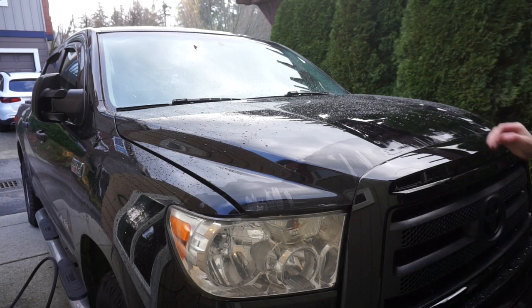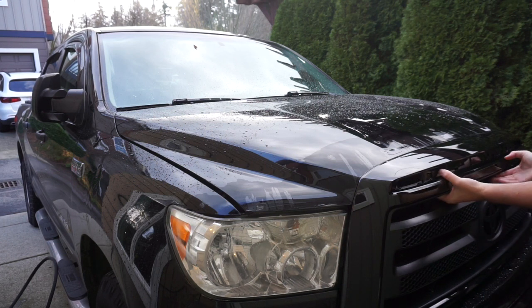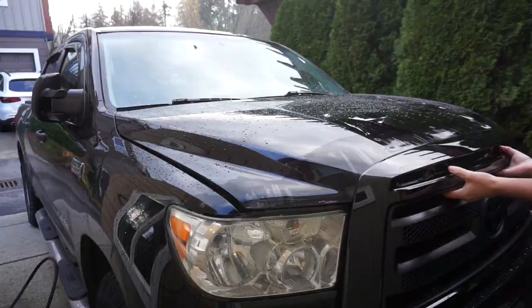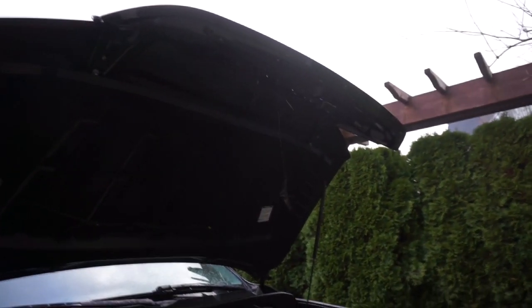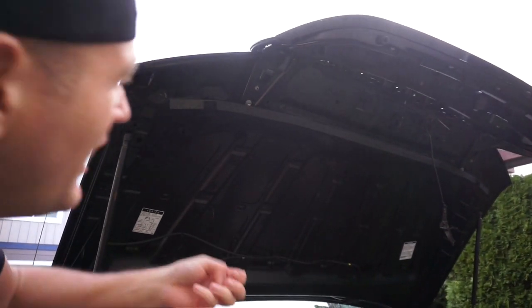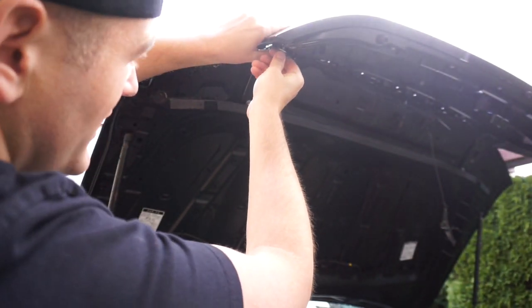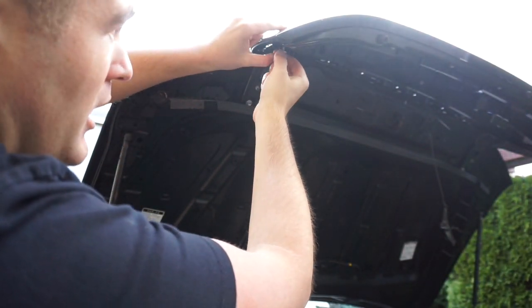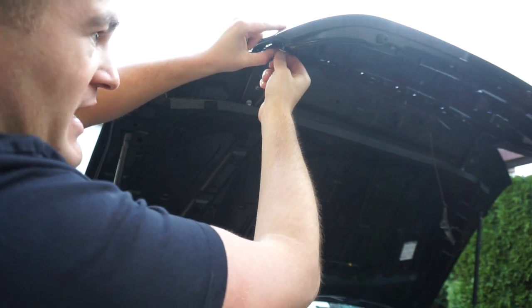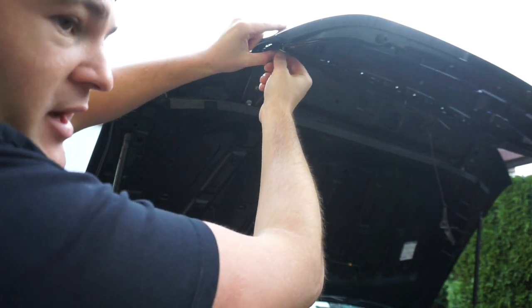Okay, I think it's unhappy because of the latch, so let's go ahead and pull it back up real quick, and we'll get this side latched. Okay, now that you've got the TRD just resting in there, you're going to want to start by going back over to those brackets that you had. Use your new supply 10 millimeter bolts and just slide them in there and just kind of finger tighten them. Do all of them first, I think there's 8 or 10, before you tighten it down so that you get a nice even seal, okay?